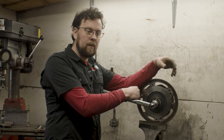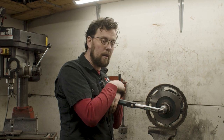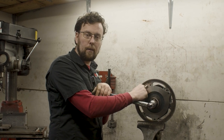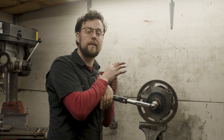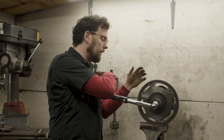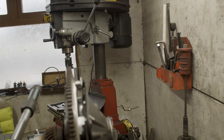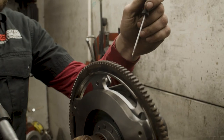You might think it's a crap diaphragm or the friction surfaces aren't right. Now I will tell you that with a bit of use this will pick up a little bit more dynamically so it will probably hold around 100 or 110, but statically it's not holding and I want to get the best static holding pressure I can. The reason it's not holding is we're not getting full clamping load from this diaphragm — the diaphragm is still sitting slightly beveled. If I put my screwdriver in along the diaphragm here you can see what I'm talking about.